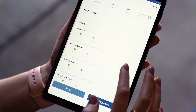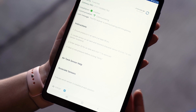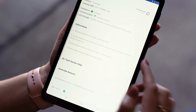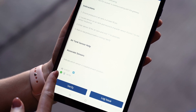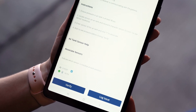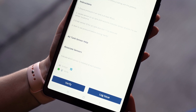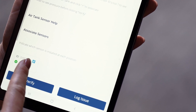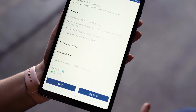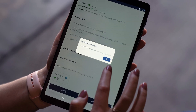Next, I'll move on to the air tank sensor. I'll need to make sure it's installed and communicating, then scroll down and make sure that I am getting pressure and have a green check mark. If for some reason I don't have that information, I might have the incorrect sensor ID, so I'm going to click this blue pencil to edit that information. This all looks great, so I'm going to go ahead and verify that sensor.